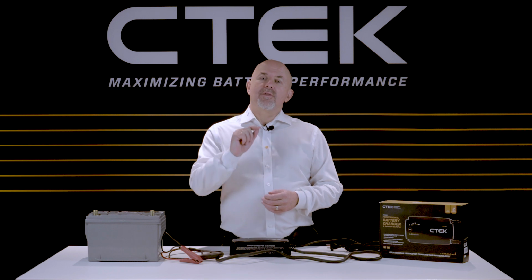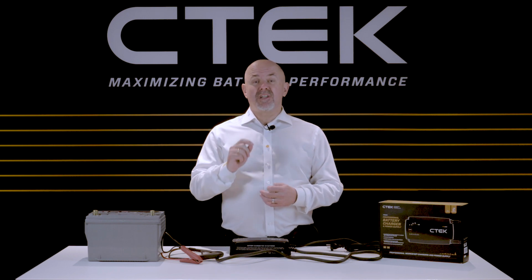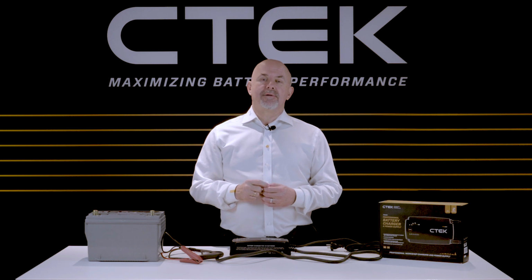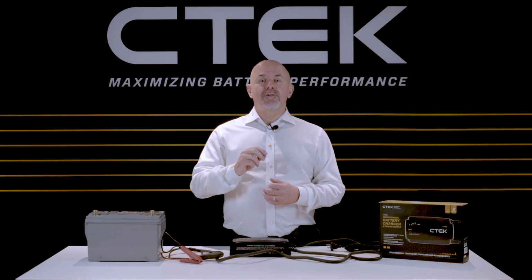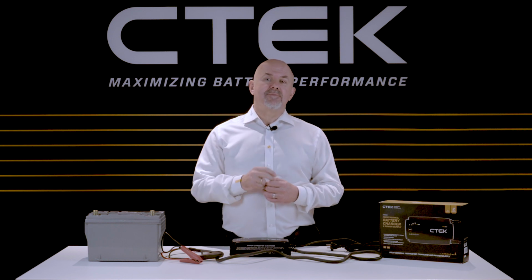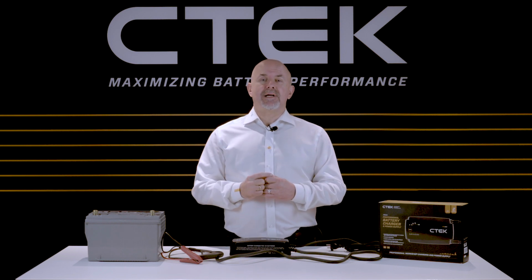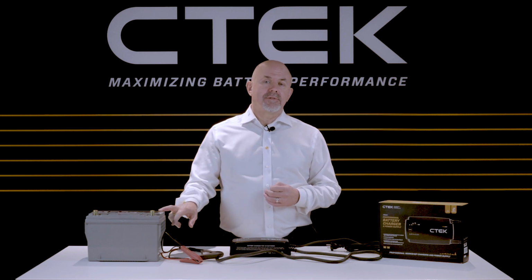Okay, one thing to remember, don't connect the charger to the power outlet just yet. Always connect the charger to the battery first before you switch on the power. Now, the PRO25S has special programs for traditional lead acid batteries and lithium batteries. But for this part of the video, we'll be connecting to a regular 12 volt lead acid battery using the battery's positive and negative terminals.